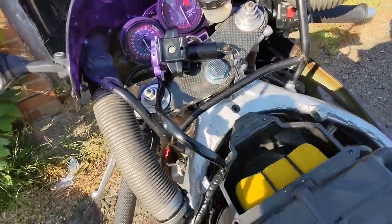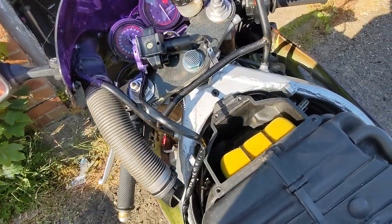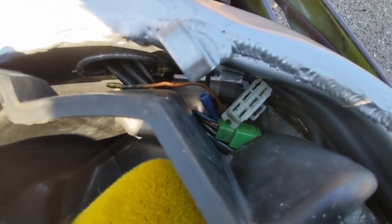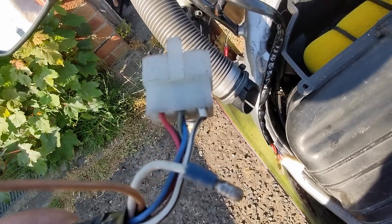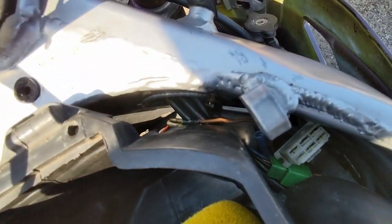So there's the new ignition barrel and there's the old ignition - it's off. However, I've discovered another little issue. It's not a massive issue, but it is an issue. That is the correct connector, but that blue connector there leads to the white wire, which seems to have been chopped off this old one for some reason. It's connected to a separate wire in that blue connector down there, and then that's the earth.